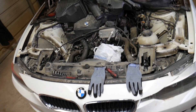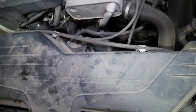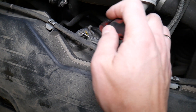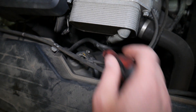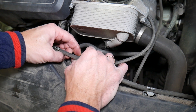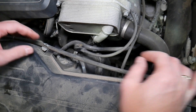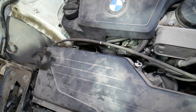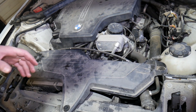So let's go ahead and remove the air filter box. We need to get one hose clamp loose — right there — getting it loose now. Then I need to disconnect the mass airflow sensor: press in here, pull it out. Now we need to disconnect that hose from the clamps. We have one more, and that's out.